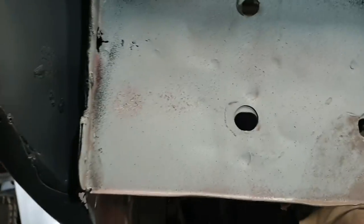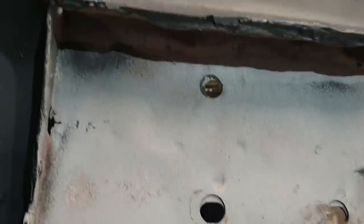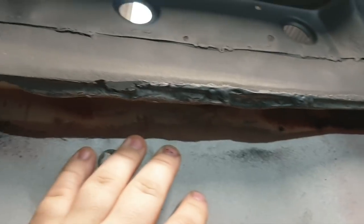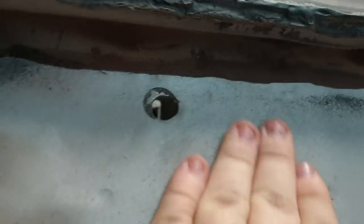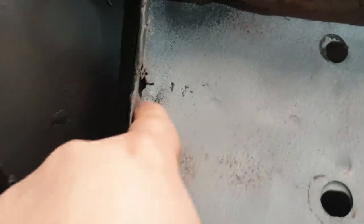First cab off the rank, we're going to have to figure out what is going on up here. I'm going to have to run a grinder through that, I reckon. You either want to drill out or belt sand. There are welds, and what you don't see sometimes is that there are actually spot welds hidden up under here. So sometimes I'll belt sand them, sometimes I'll drill them out.